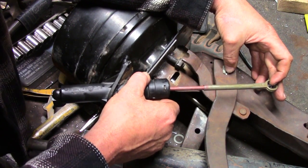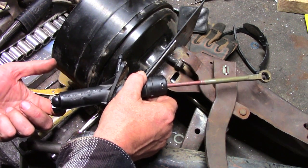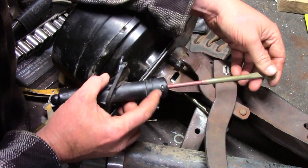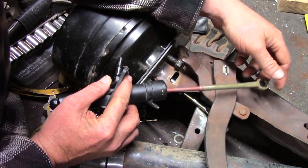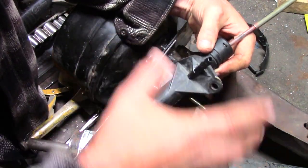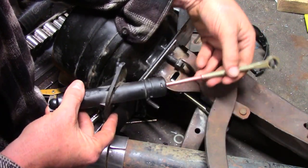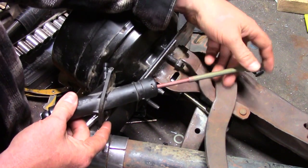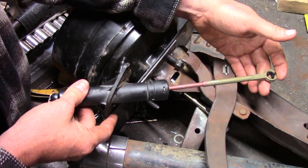I can probably move this up a little bit, but I still have to make sure I've got clearance for steering and stuff, and the pressure line has to be able to pass over. I'm going to go check underneath the dash to make sure there are no clearance issues up in this area. I think what we're going to do is take a piece of sheet metal, cut it, and drill it so this thing will mount, then rough it in, tack it in, and build around where it goes. That's the best I can think of right now.